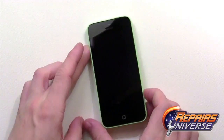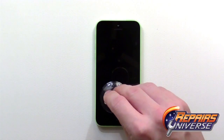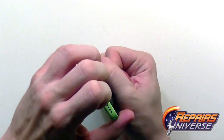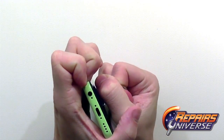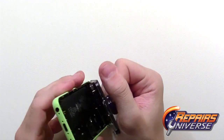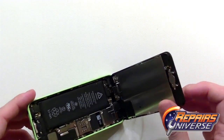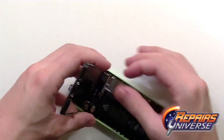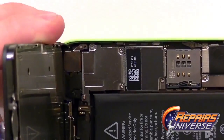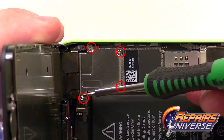With the screws now removed, take a suction cup and place it towards the bottom of the screen near the home button, and use it as leverage to pry out the screen assembly from the housing. Once you've reached enough gap, the screen assembly can be lifted upwards. Be cautious as there are still three pop connectors held onto the motherboard. With the screen assembly flipped up, you can see four screws to remove — all small Phillips screws of different sizes, so keep them separate.